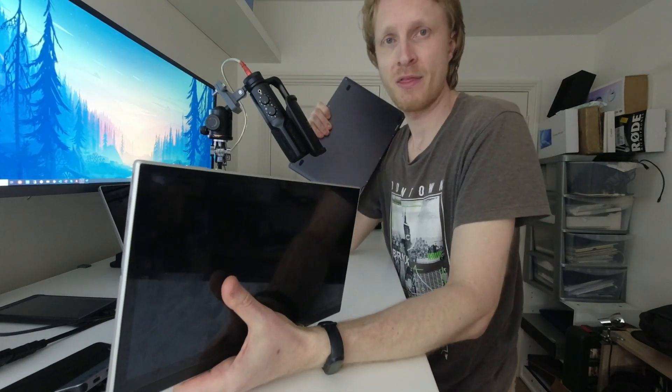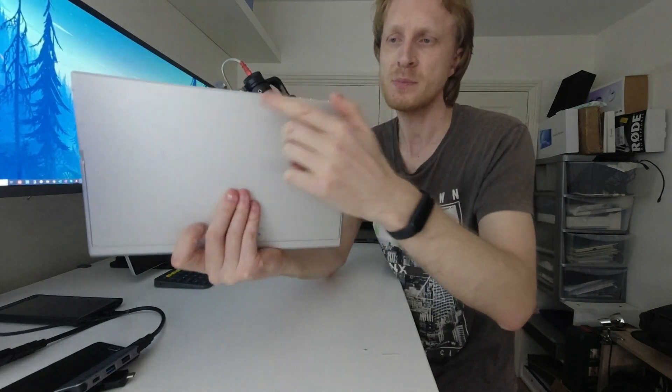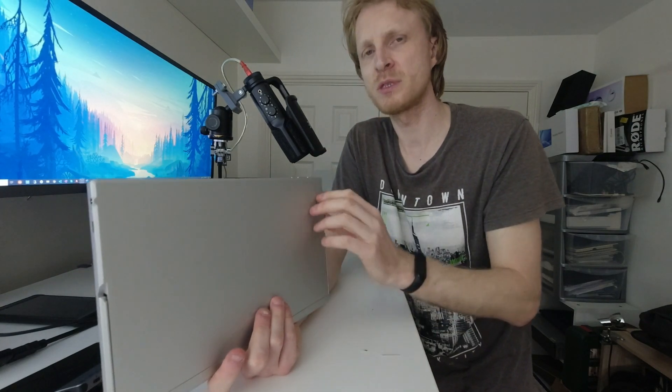According to the website this display has a 10,000 mAh battery, but the manual says 5,000 mAh. After testing, I'd say it's very close to 10,000 mAh — fully charged it lasted around 5 hours during video playback, the same as the UPerfect X which definitely has a 10,000 mAh battery. I wasn't using the supplied power brick; I used my Nexdock 2's 60-watt brick, and charging was really slow. The area around the charging port was getting noticeably warm, possibly because my power brick was more powerful than what was supplied.